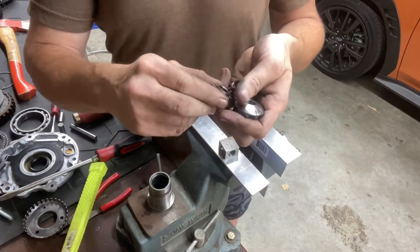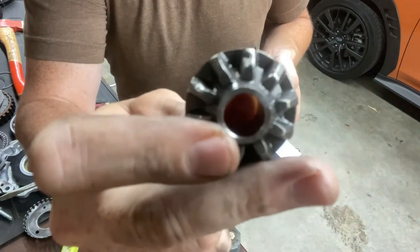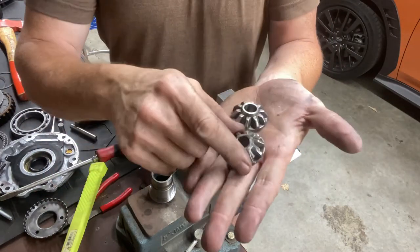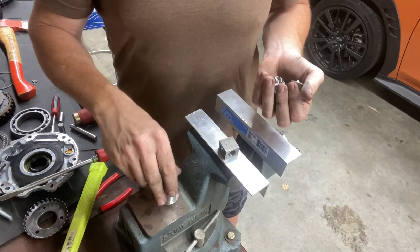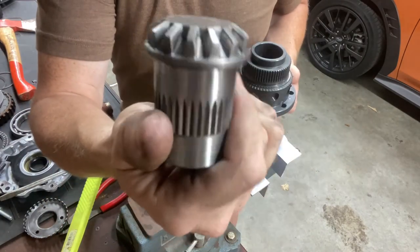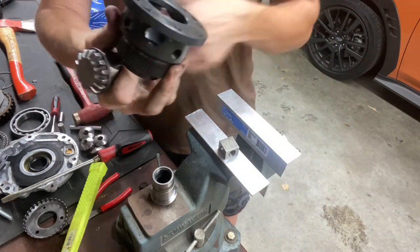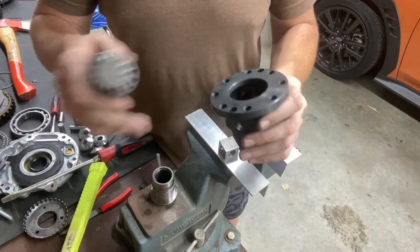As you can see, some of these gears are okay. That one's got a little ding on it from this one breaking - something had to give. And this one's got a ding too. So this diff will get four new gears and two new hubs - this hub and then the hub from the other side. The hub from the other side is pretty much fine, so you can keep it as a spare. That's how you get it out - it's not incredibly hard. I just figured I'd make a video because I didn't see anyone else that made a video on how this smart lock comes apart.